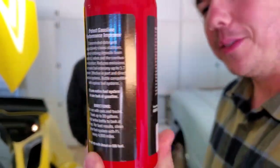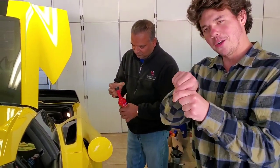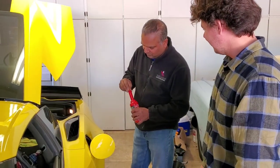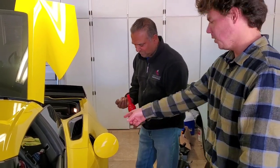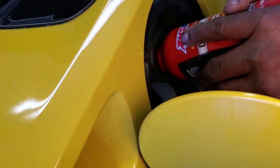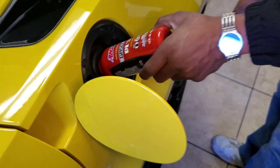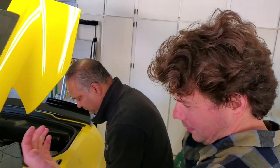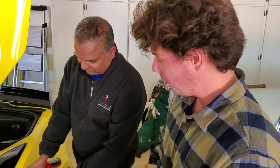You put this in every 4,000 miles and you've got the honors. All he's going to do is pop this lid — you push in, fold the little flap, and peel. Push in the middle and he's got it. Now you shove it in. This is the double gas cap compatible nozzle, so shove it all the way in and penetrate both flaps. You've got a deeper flap which is the seal, and then the outside dust cap. You need a nozzle long enough to get through both of them. If you want your car to run longer and stronger, you're going to want to put this stuff in your car. It's going to really clean it up and make a lot more horsepower.